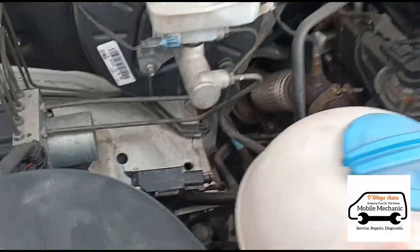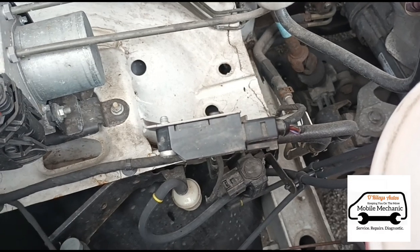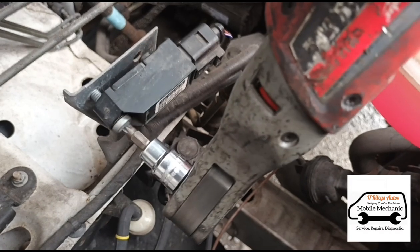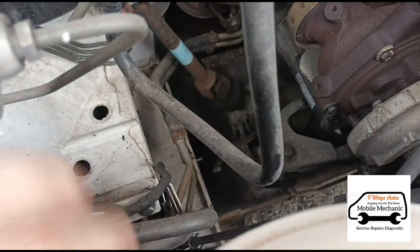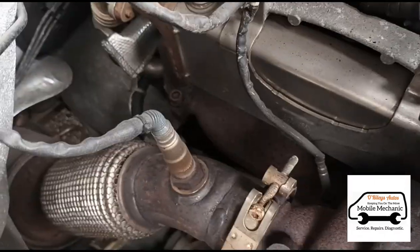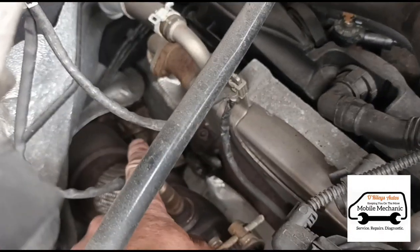If we come down to the driver's side of the vehicle, we have the DPF pressure sensor. That is a T30 Torx bolt there. We'll open that up and disconnect the pressure hose. We've disconnected the pre-DPF side — if you follow that hose down, it runs down along to the DPF, just down there on top. There are a lot of tubes in the way.